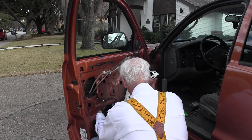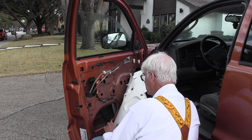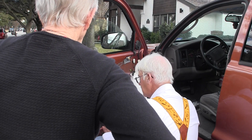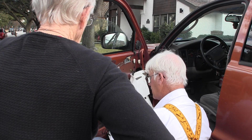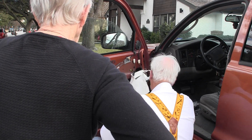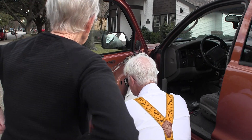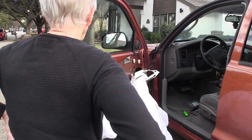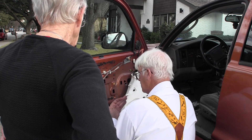How's it going? Oh, it's going. I got it together and apart and all that, but here's my issue. The noise it's making — the cable here is hitting this part which holds the window in place. It's hitting on this here, so I'm trying to figure out why that's doing that. It goes up and down, it's supposed to, but it's catching. You need to have some kind of mirror to look in there. Well, I can see in there — I can just look right in the hole. If I hold the cables close to me like this, it's going to catch.